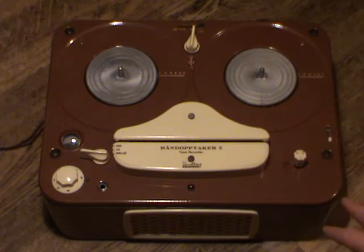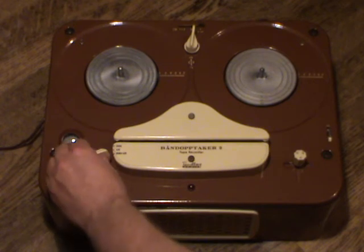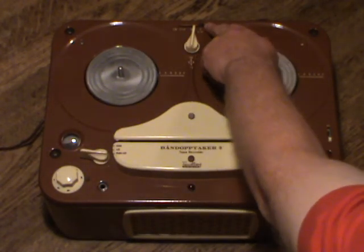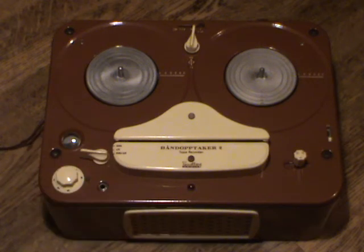The machine has a very basic feature set. In those days a tape recorder was very expensive, and they had to keep the price at a reasonable level. So there's the joystick control, a volume control, recording and playback amplifier selector, two tape speeds, a loudspeaker selector, a power switch, a recording level indicator, and a pilot lamp. That's really it — a basic feature set. The only thing they could have simplified further would have been to remove the speed selector.